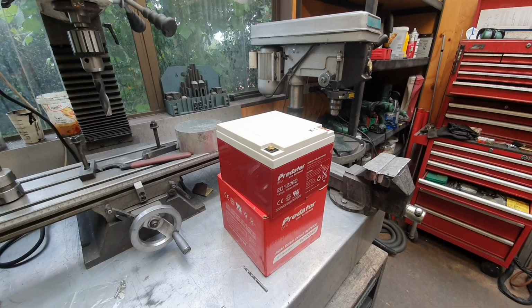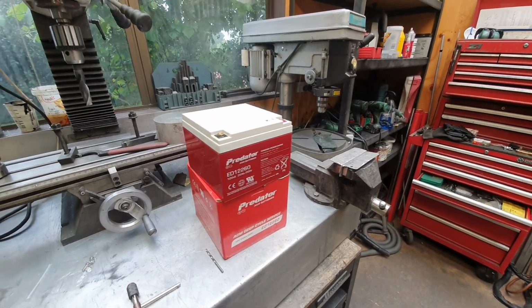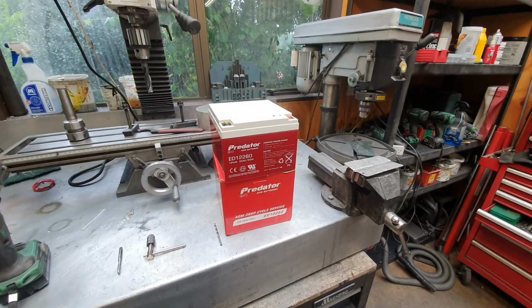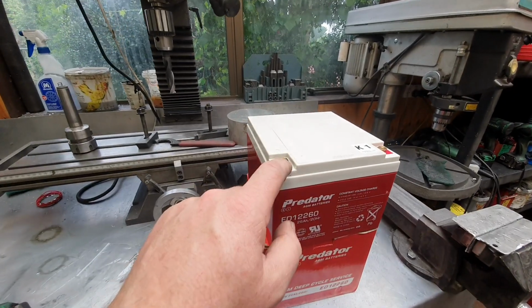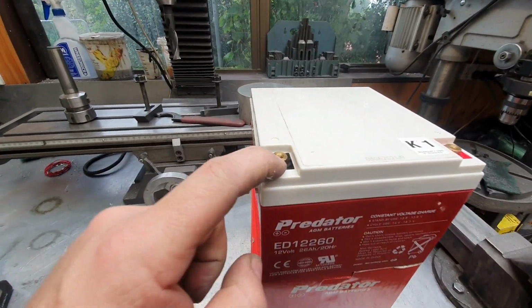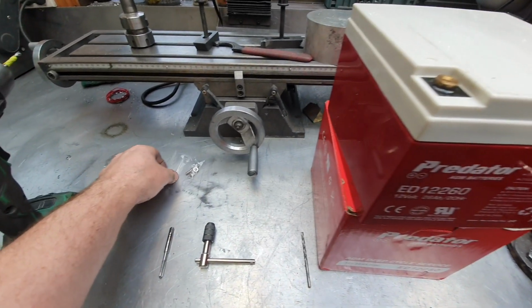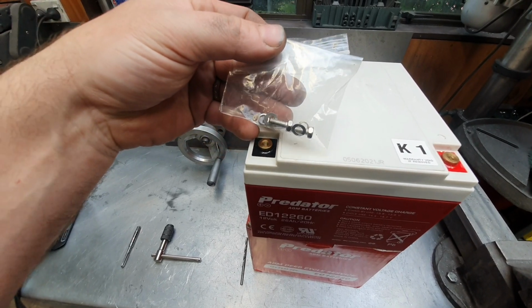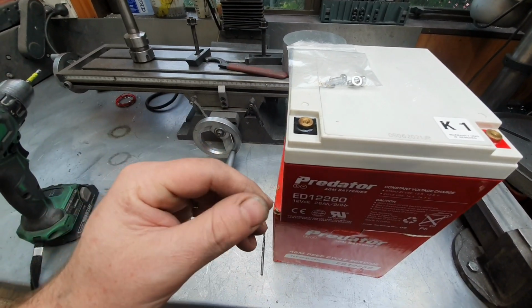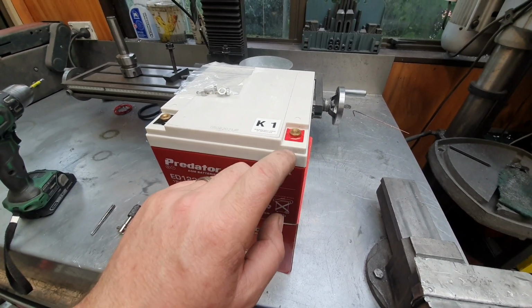Fake carbon fibre. So we're going to get on with, first of all, the same as almost everything with the March. Nothing goes in there without being modified. We've got piddly little M5 studs on here. Little wee M5, itty bitty tiny. These are things to hold model airplanes together and model cars, not deliver many cranking amps to a big 3.5 litre V6 with high compression pistons in it.